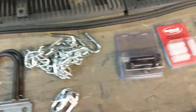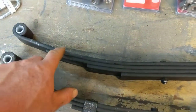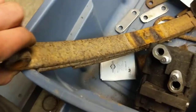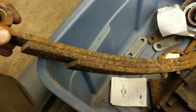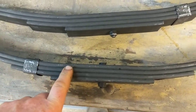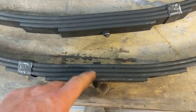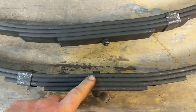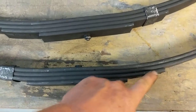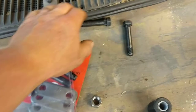We're going to cut the chain in half and put one of those anchors on each end. We also got a pair of four-leaf springs. Our old axle had a three-leaf pack, so we thought we'd go with four because they were the same price. I've done this before on our boat trailer - we actually removed two leaves there because the boat didn't weigh anything. If the trailer's too stiff on suspension we can always take one leaf out and make it a three-pack.